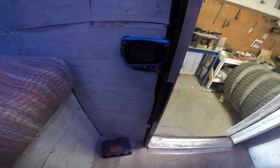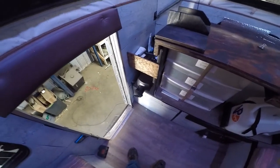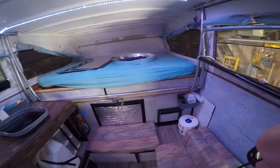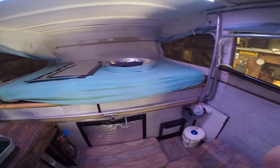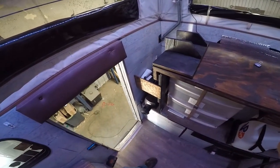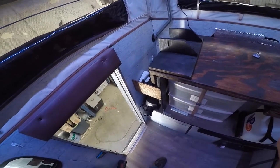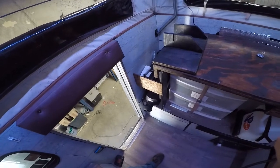This is the diesel heater control, and the diesel heater lives over here. It's not permanently mounted — just stuck on there so you can do whatever you want with it. I believe it's either a five or eight kilowatt heater. Either way, it'll run you out of this thing in the winter. I camped in negative eight degrees Fahrenheit with it only turned up to about three quarters, and I was burning up. As far as diesel use goes, it has a two-gallon tank on the back. In the low teens or less, that tank lasts about two nights — around 10 to 12 hour nights. In the twenties or above, you can get about three to four nights off that tank.